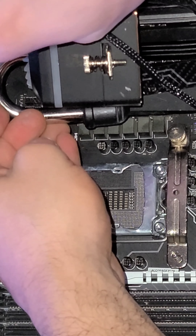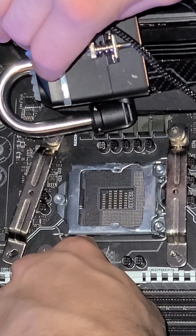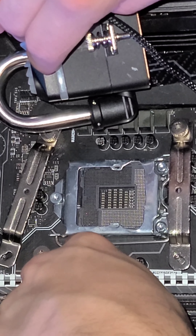First, we have to check whether you have a fan-based cooler or a liquid cooler for your CPU. Look at the housing of whichever one you have — most of them work the same way, using pressure from screws to hold it down to the CPU. Check your manufacturer's instructions on how to safely remove yours. Now, as you can see, I've removed the screws.